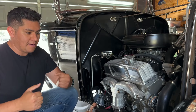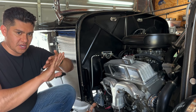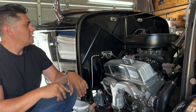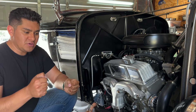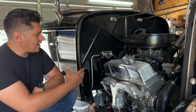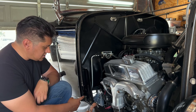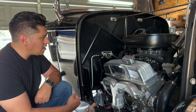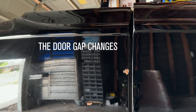Welcome back. In this video I want to cover an issue I've been neglecting. Depending on the road I'm on, what I'm noticing is that my firewall is staying stationary and my cowl is moving, or vice versa — kind of an oscillation. Since my actual steering column is bolted to a bar from one end to the cowl to the other, I notice that shift when the road gets rough. I can see the movement, so I know that these cow feet — which cinch the body onto your firewall — are not tight enough. I can't just tighten down those bolts to the cow feet, because then this happens.